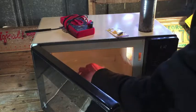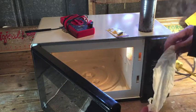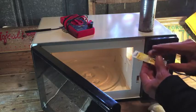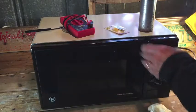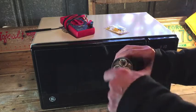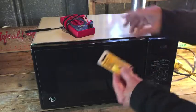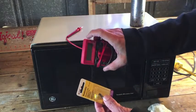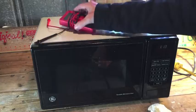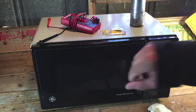So if your microwave dies, don't automatically throw it in the trash and buy a new one. It might be a cheap and easy fix — it might just be your fuse. And be careful around the capacitor. You can really hurt yourself if you touch the terminals before it's discharged, so be careful. A couple of links below — I'll put a link to the fuses and the multimeter. This is a cheap one from Harbor Freight, probably costs about six bucks. I hope this helps you out. Thanks for watching.